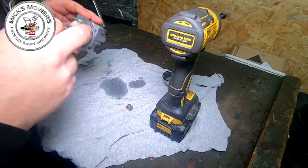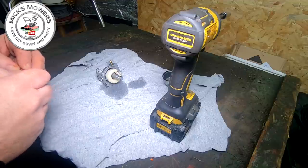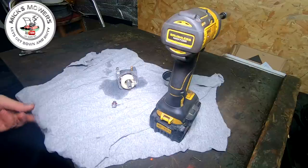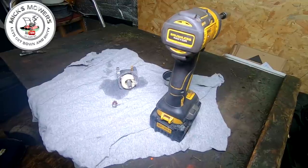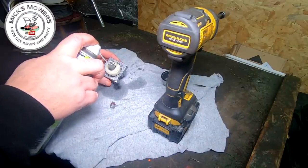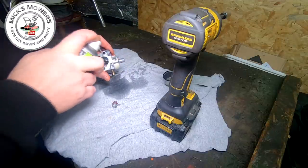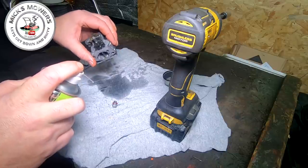What I may do is just put some carburetor cleaner down inside there. It doesn't need cleaning, but I just want to respect it because sometimes they run right for a little while but after that it won't run at all. So a quick little bit of carburetor spray straight down the head of that main jet just to make sure it is open and working as it should be, and then I'll put it back together. No need for a full carburetor clean here. As the O-ring has actually come off with the bowl, I can afford to use the spray. Let's blast some carburetor spray through there — he's got a brass seat, so no need to worry. That's good enough for me.